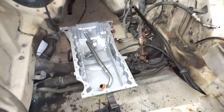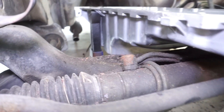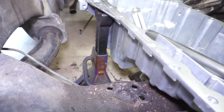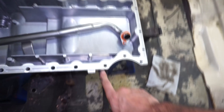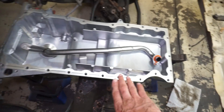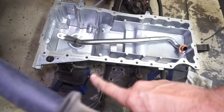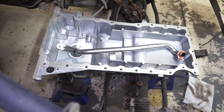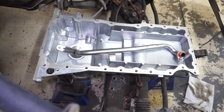The fitment for the pan on the rack honestly looks pretty good. I might be able to extend the sump a little bit, so I'll evaluate that. What I'm thinking is I might just cut it here and extend the front portion, because this rear section actually fits pretty good. I may or may not want to add a little bit on there just to add some more capacity, but I'll have to measure it out and see what we actually get.